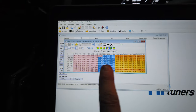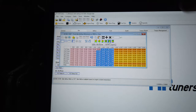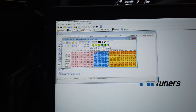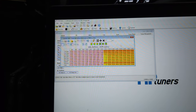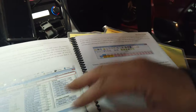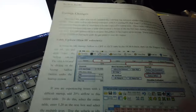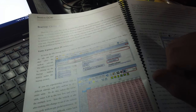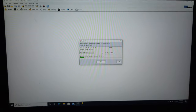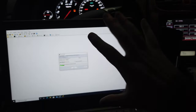Here's one of the tables — I went ahead and added idle airflow. HP Tuners is a little quirky: I put 1.2 in this box, multiply by that, which adds 20% and interpolates between bounds to give us that table. Then I come over to the book, go to the next section on startup changes, add a little to the startup airflow — that'll help the car start up too. I'll go through the table, add what they recommend, and go from there.